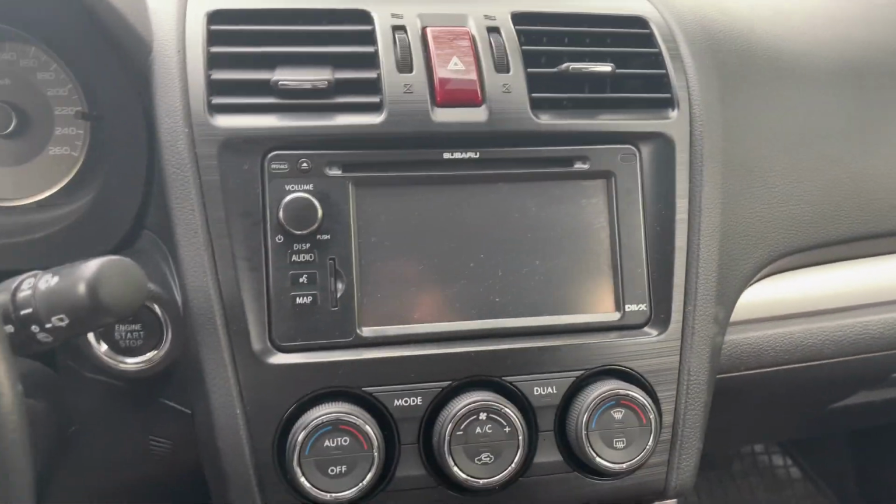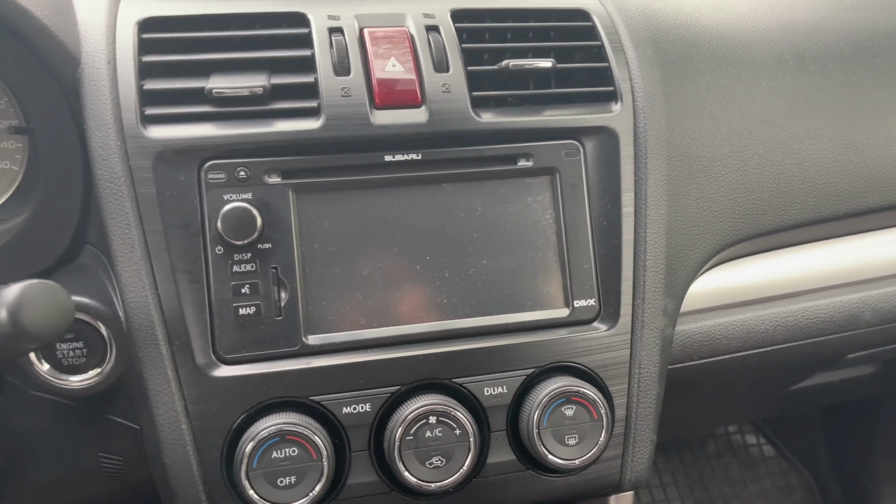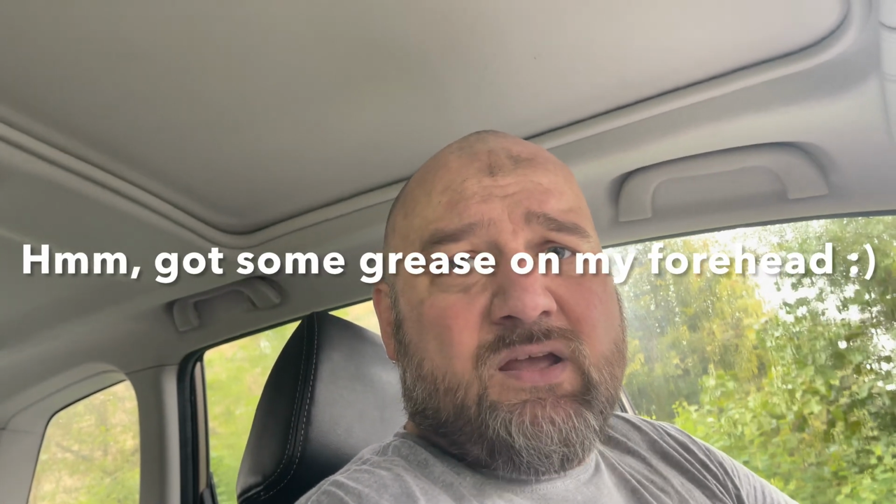So when it comes to the radio, in general it works, although it does forget the station sometimes. It doesn't connect to Bluetooth. It connects, disconnects, doesn't recognize the phone. So I believe it's probably the capacitors which dried out. A common problem with some electronics. So we need to replace it.